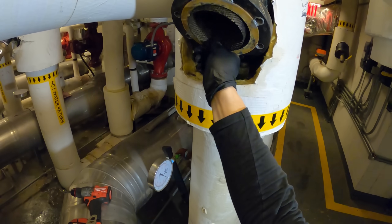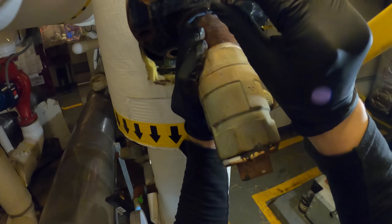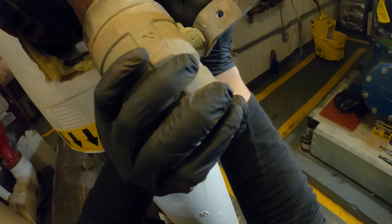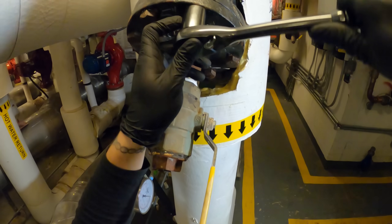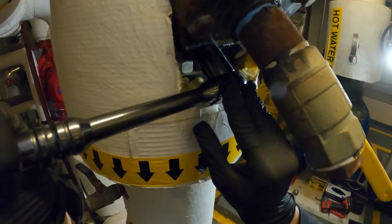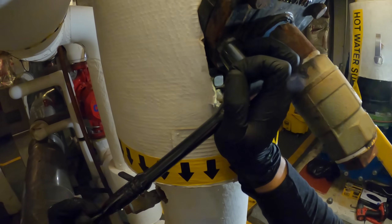Put the strainer in here — if it's popping out, if it stays, it's good. Or you can lay it on here and push it in, because it stays around this groove. Let's set this up, put our bolts in, line up the holes, and feed the bolts through. Get that started and go one by one. I'm going to preserve these bolts and it's going to make it so much easier to put in next time. We're going to snug it — and like I was saying, we're going to go across each time. If you just go one by one you'll notice some parts are not going to be tight; they're going to start to loosen up. Go across, and so forth — that's how you do it. Once you've done that, quickly check around each one and make sure they're snug.